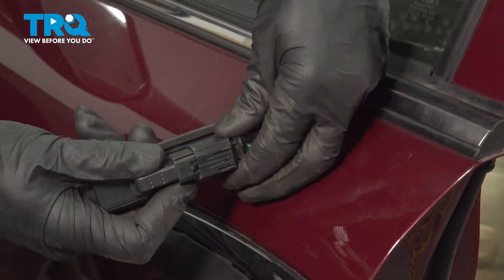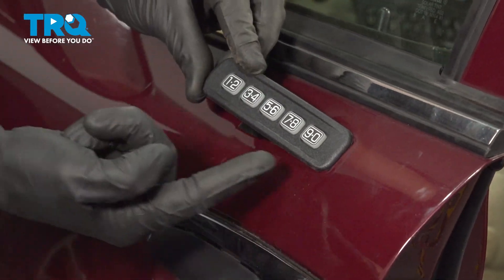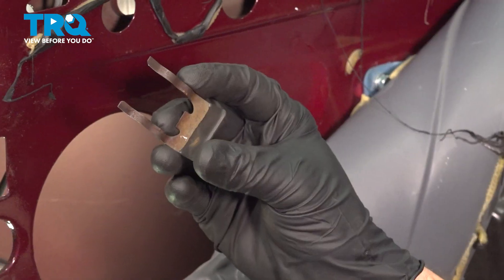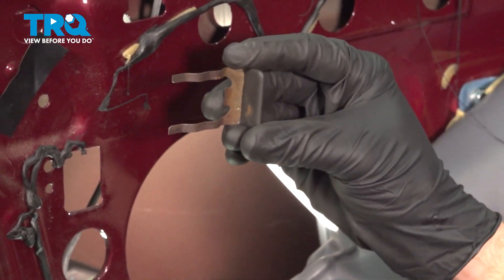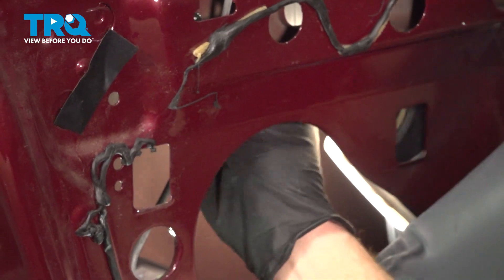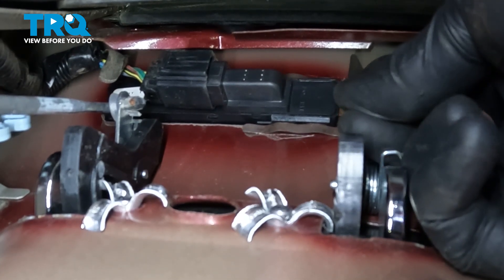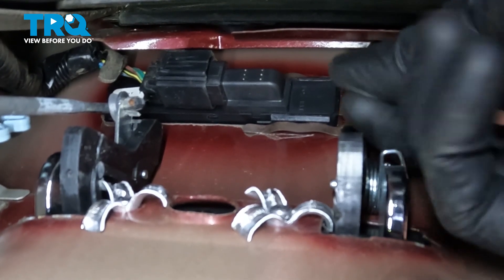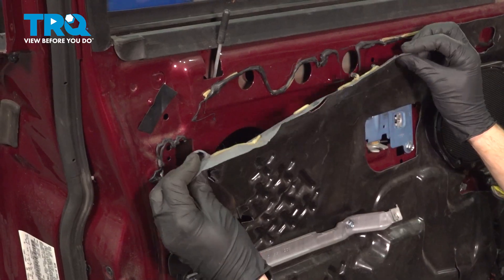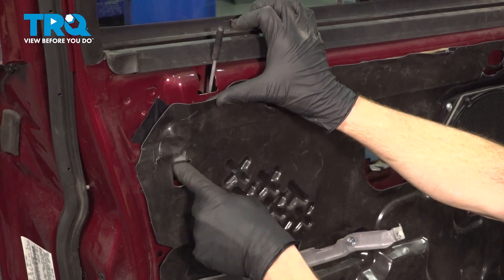Connect in your electrical connector. Give it a little click and make sure that's secure. Let's put this in place. Bring it down at an angle, sliding this area down and behind the door. Gently press it in. Make your way inside the door. From the inside, we'll continue on by sliding in our clip from the right side towards the left, sliding this around the keyless entry pad. Press that in as far as you can to make sure the keyless pad is secured to the door. Take a quick peek on the outside to make sure it's seated properly. Let's stick this back to the door in its original positioning. Now make sure you push this through that square notch.